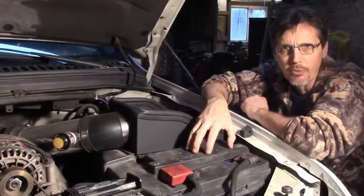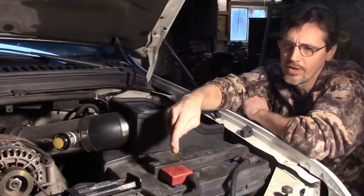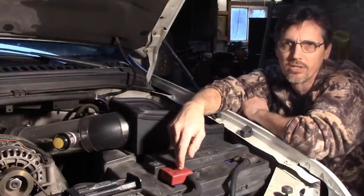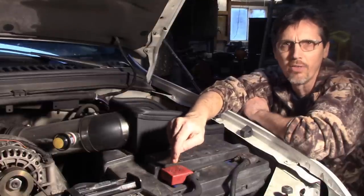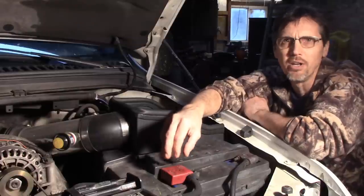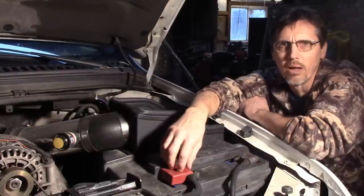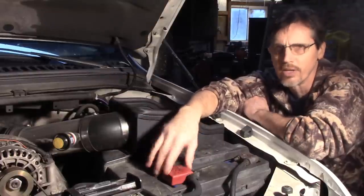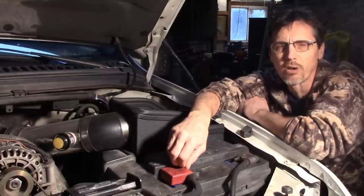Keep in mind with these diesel trucks — since they have two batteries, when one battery is removed this positive cable will still be hot. So either remove both batteries or put a bag or something on the battery cable to make sure it doesn't make contact anywhere. If you remove both batteries you lose all your radio memories and clocks. So we'll keep one battery hooked up, wrap this terminal and make sure we're safe.